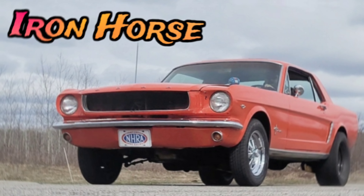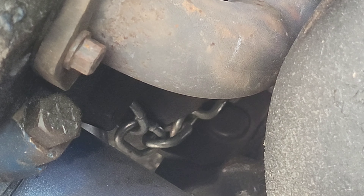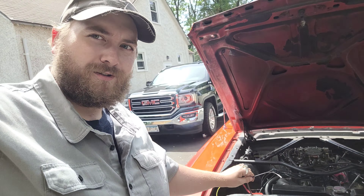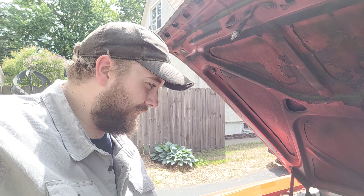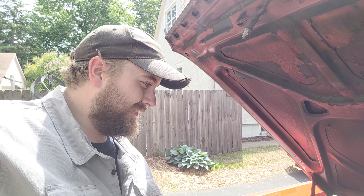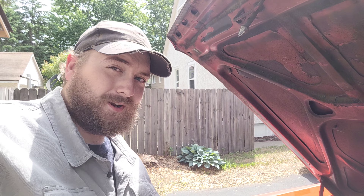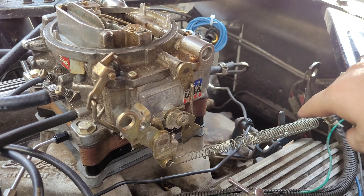This video is going to shock some people. A while back, we had fixed our broken motor mount and made it a solid mount, which eliminated the engine from flopping around. I'm sure it had been flopping around for a long time and I just never noticed, because I never had the hood open while the car was in gear. It wouldn't flop around in neutral or park when you're just revving it, but when it was in gear, it would. And I believe that was the cause of my sticking full throttle issue.